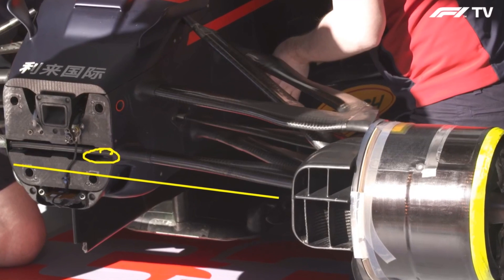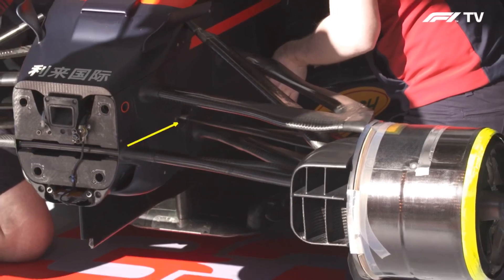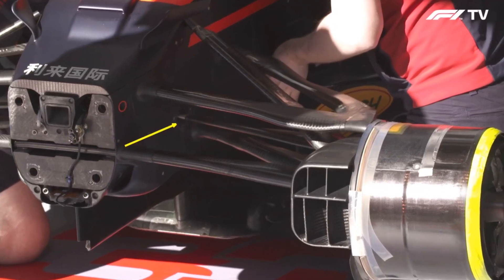So it's picking up on these outboard points, as you'd expect with these flexured mountings. So it's not a solid beam that goes through the front. But there's no steering rack. Where is it? It's moved rearward, and you can see the steering arm has moved way back in towards the driver's feet.